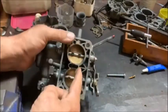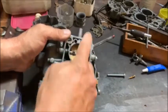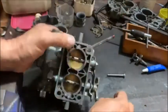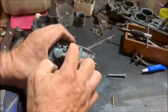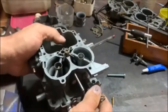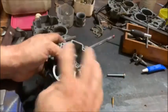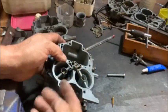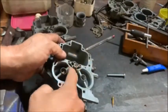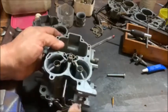What you have to do — because this is the 38 — you've got two idling mixture screws. In this one you must put a jet in, screw it in all the way, lock it in place, and forget about it. You'll need to put an idle jet in there, but that's fine. Also remember this is now your first choke, so the accelerator pump on the 38 would spray in both — that's not going to work. Because this butterfly only opens later on, you can have a lot of fuel lying on top of it and it's going to have a massive flat spot. So you must put an accelerator spray pump in that only sprays on your first choke.